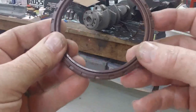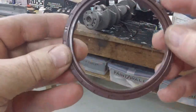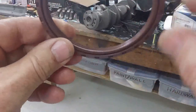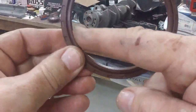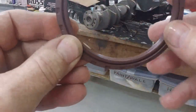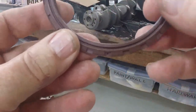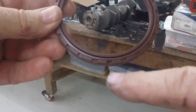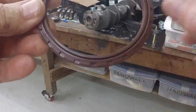This is one of the new B.O.P. one-piece rear main seals. You can see that it is continuous — it doesn't have any breaks in it. And it also has two sealing lips on it, which you're supposed to put some grease in there before you install it, which helps to lubricate and also to help seal it. Right here in this one little spot, there's a little circle or a little hole in one of these square notches.